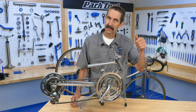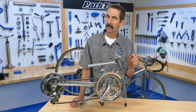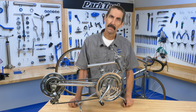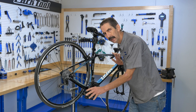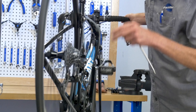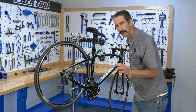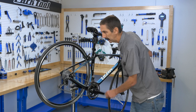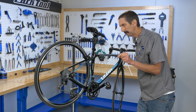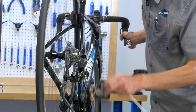Nowadays we have the modern click, click, click — the mechanic's got work to do. The modern indexing bike is a wonder: you pedal, push the lever, it goes tick-tick, up one, two, or three gears as you like. Everything seems good — and it is good. But for the mechanic, setting the limits can be tricky, because the indexing feature can hide limit screw problems.